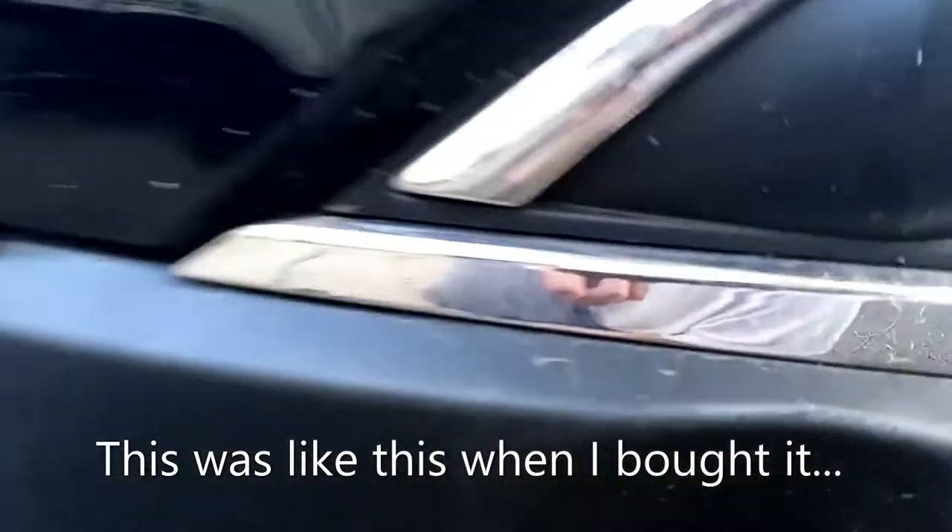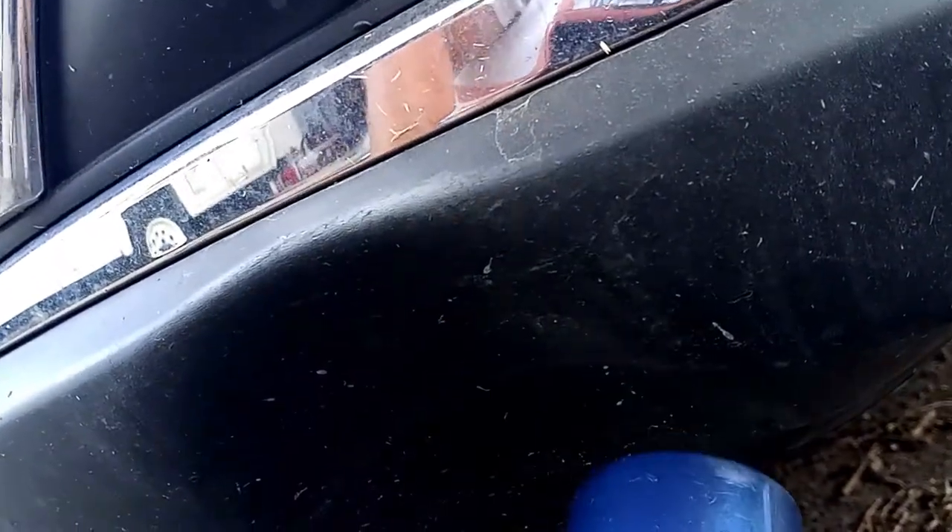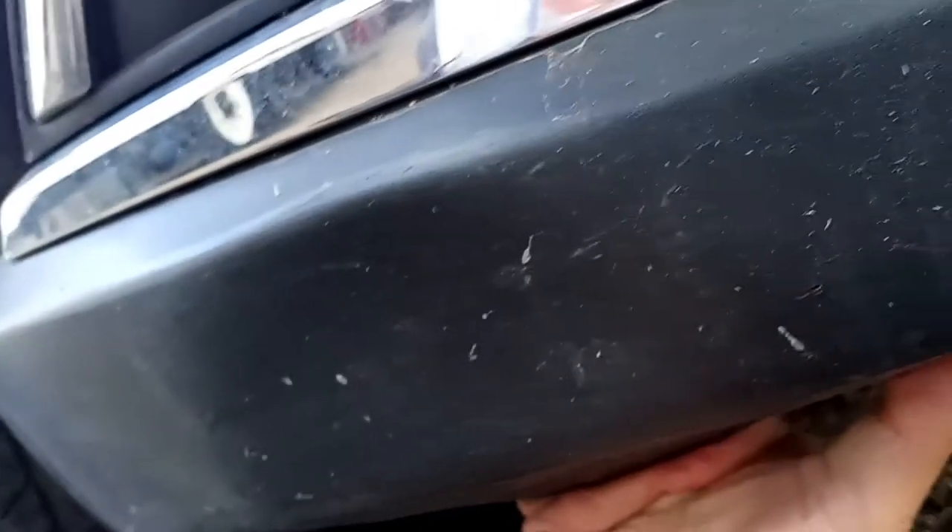It's an unpainted surface — looks perfect — but let me show you how to fix this cheaply and okayishly. Turn on the hairdryer, warm up the plastic, and push from behind. Make sure you move it around so you're not burning one spot. There you have it — push back out.